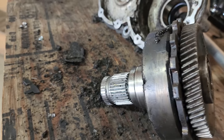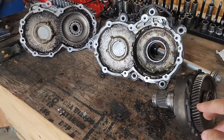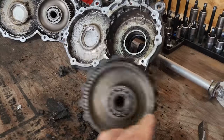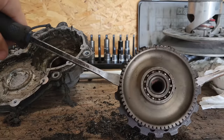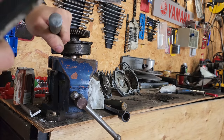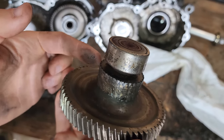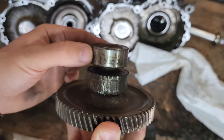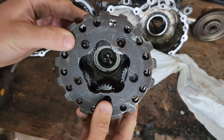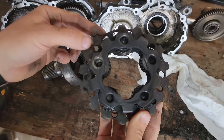Last episode we got the diamond drive out of there. I didn't really care about that when I bought it. Here it is — this is what happens when you run your diamond drive dry of fluid. You guys did want me to break this apart and show you the screwed up planetary gear. You can see how welded this pickup gear is into the orbital gear — the pickup gear teeth are completely stripped off by all those smaller gears that orbit it.